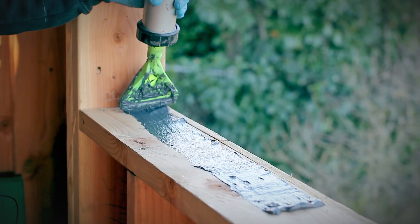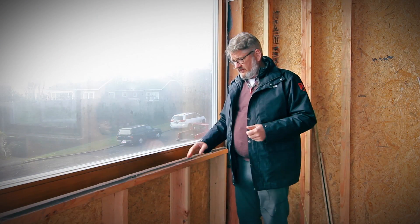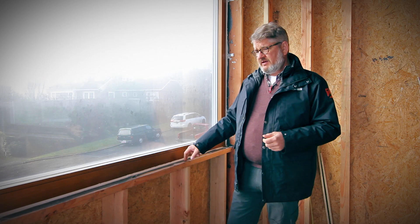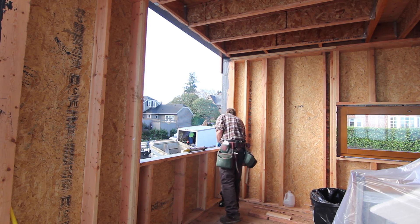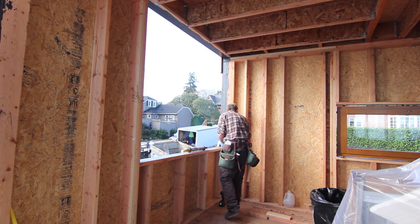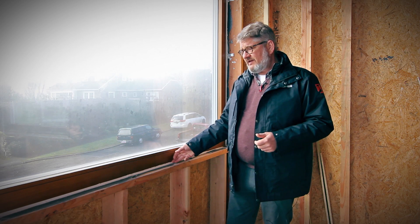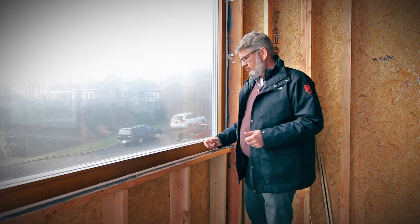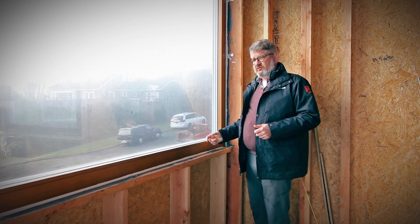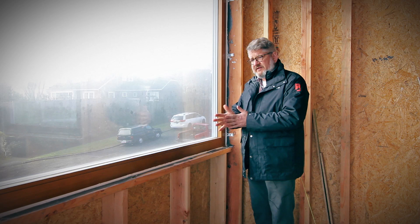It's self-healing and vapor permeable. We've prepped all four sides of the opening with this. We've got a sloped sill pan here, and the black material goes all four sides, wraps out onto the face of the building to accept the fastener load — so it heals around those fastener shanks around each punched opening — and comes to the inside of the rough opening, giving us a seal to which we can in the future apply our air dam, which you'll see towards the end of this sequence.